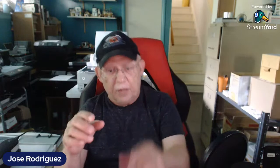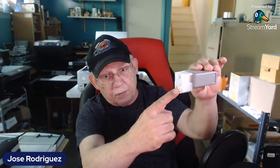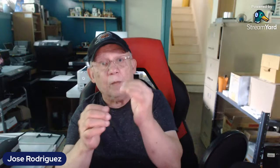You have a cartridge. Let's start from the cartridge. This does not move. It sits in the front. There's a gradual drop to the bottom, the floor of this cartridge, sort of ramp down, the port right here. And it connects to your printer. Beyond that is a piece of tubing. I don't know whether it is flexible or metal or whatever. And there's a valve that either opens or closes. So beyond that, there is a compartment, one for each color. And a certain amount of ink is constantly stored in those compartments.